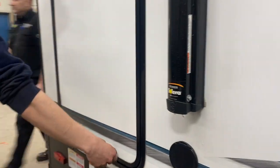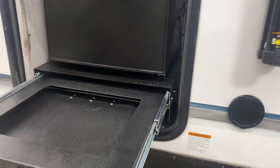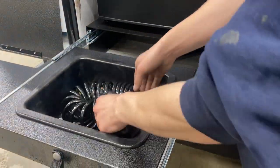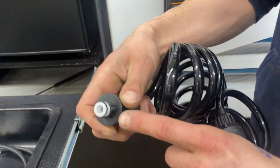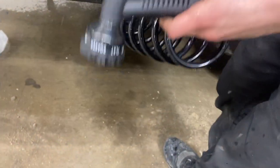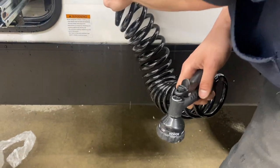To set up the rear kitchen: unlock and open that compartment — there's a magnet on top to hold it open. Pull this drawer out, slide it to the left, and open up this little lid. The sink drops into this hole; you can see the hose here. It has two little ears — pop open the port, line up those two spots with the ears, press it in, and give it a quarter turn to lock it in. This is cold water only, and it's automatically pressurized by tying into your water system. When done, pull it open and stretch it out, then open that valve to drain any remaining water.